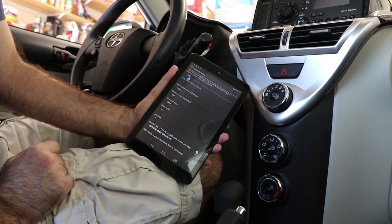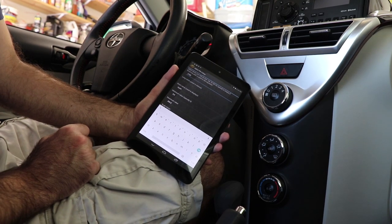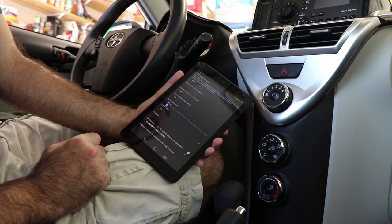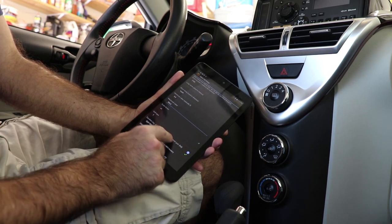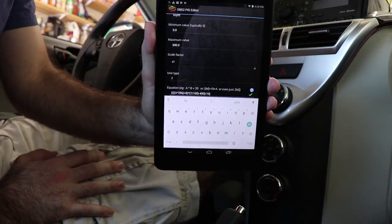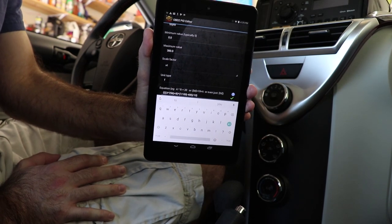And up here, you give it the name of the PID you want to add. And in that case, this is 2182. You set a minimum and a maximum value. And then you get to the important part down here. And you enter this whole long equation. Here, let me zoom that in. I'll also add this in the description so you can copy and paste it if you need to.